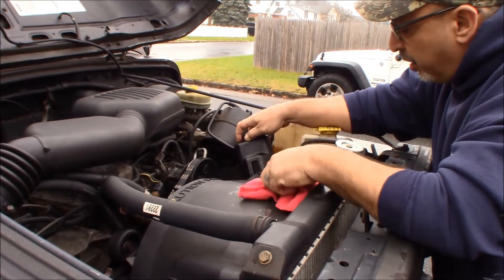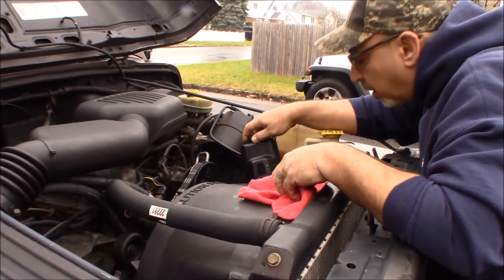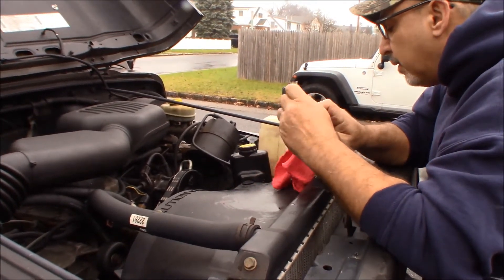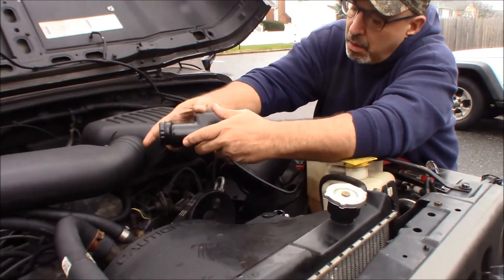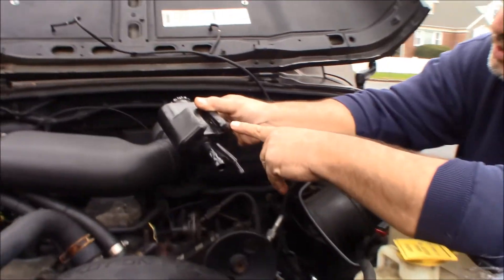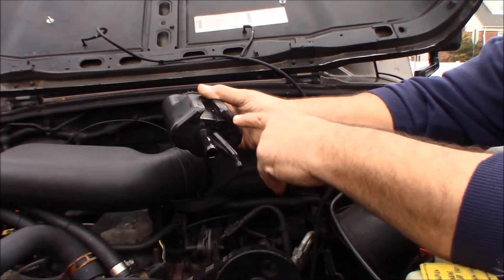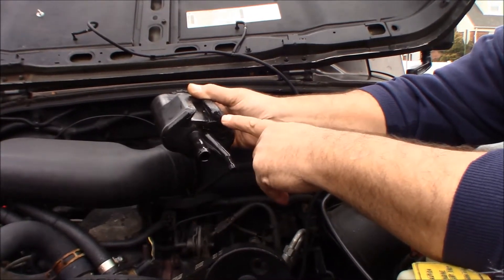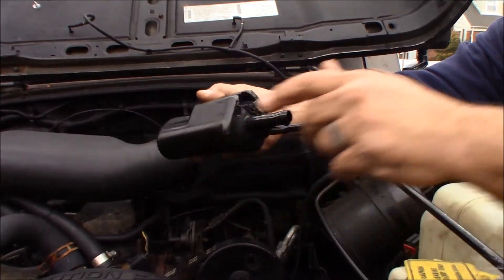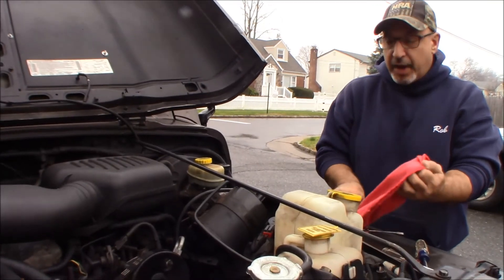That's why this one's different — it slides on there, and all her things are leaking down there. This is where we made our plastic repair that didn't hold, so we're going to pull this thing off and try something different. We added some mesh steel reinforcement and some plastic for a hole that was maybe a couple of millimeters wide, but it's just not making it oil-tight. It's not under any pressure in the reservoir itself, but it's just not doing what we anticipated.